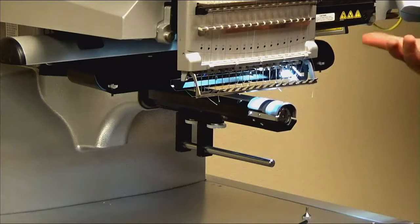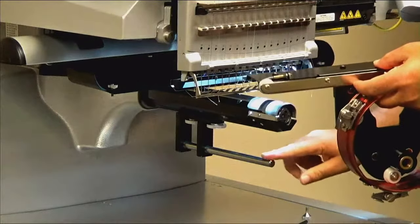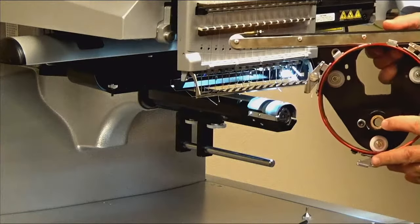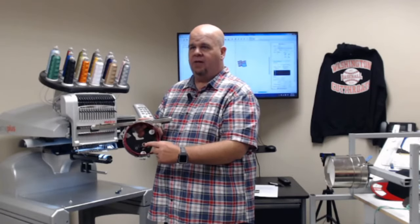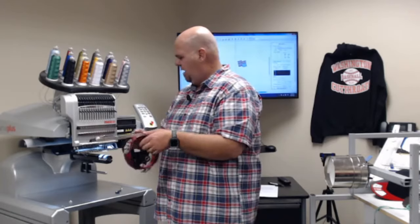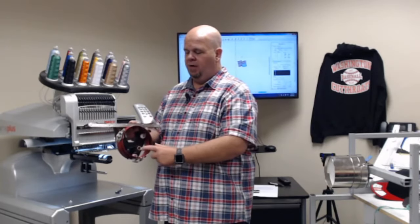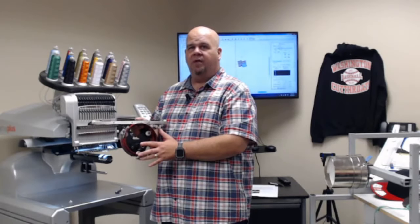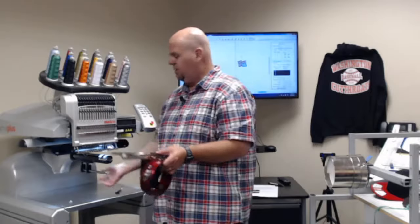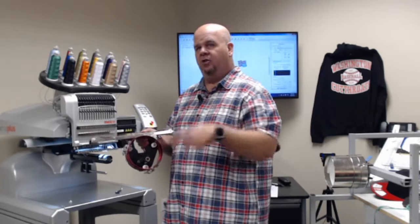There are two types of blocks the shaft goes into. If the block has a brass color on the outside, you'll want to oil it after installation — add a little oil and move the frame forward and back to work it in. If yours has bearings — little rollers — instead of solid brass, do not oil it; it's self-oiling. You do want to clean the shaft on the bearing type because it will pick up lint and residue.